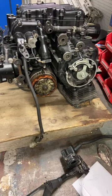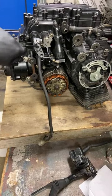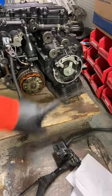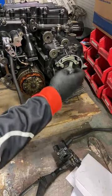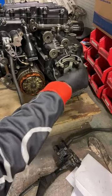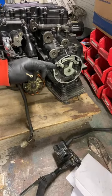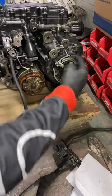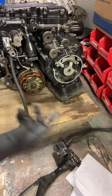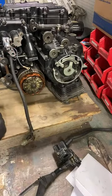Bolts, so I'm just gonna pull the bolts off this thing. Steel goes into the steel bucket. Aluminum will go into the aluminum. Copper to the copper. What else is on this side? Here we have a chunk of steel working as a crankshaft position sensor. The electrical components, whatever was here, are gone, but there's a notch here in the engine casing. Something was spinning here, and when this chunk of metal was close to a magnet, the sensor was just a magnet, then it would generate a current. Crankshaft position sensor on this side.